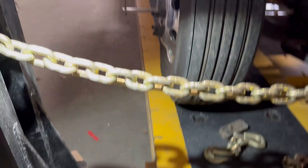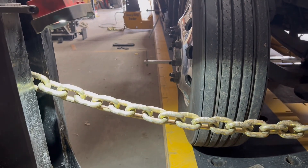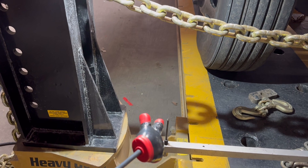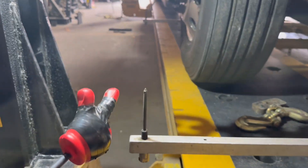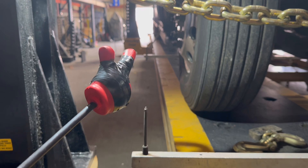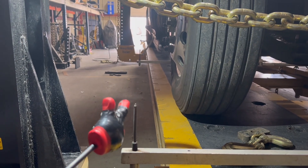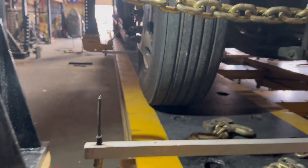We have moved her about two and a half inches. This is a fairly new truck, really nice truck, low miles — was in a minor accident. We're pretty straight right now, but we need to be just past this pin because when you take off and drive down the road the frame is going to shake and go back a little bit, because these frames are extremely flexible. A lot of people don't realize that frames are flexible.